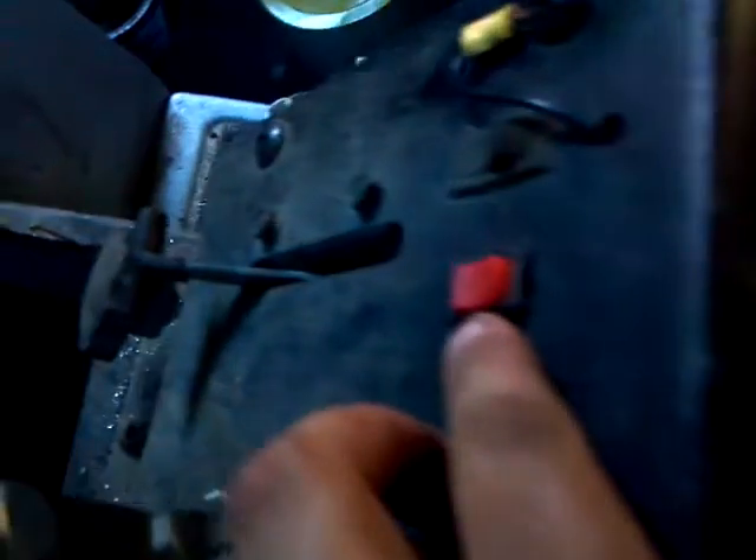So to make a kill switch — this is your ignition. Over here I made a little switch, and when you flip it off, even if the ignition is in the on or off position, the motor will stop. But before you go to crank it, switch it on and then start it, so your mower will crank.